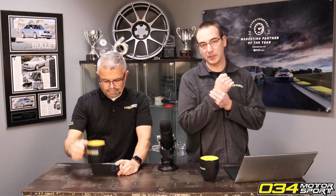We currently recommend the Wagner intercooler kit, which does a nice job at this power level. Just because you have an intercooler kit doesn't mean it's going to be sufficient — for the time being, the only one we can validate or recommend wholeheartedly is the Wagner. But if something looks like it's a sizable upgrade over factory, that's great. We're running the full kit — heat exchanger and intercooler.